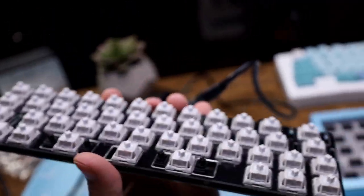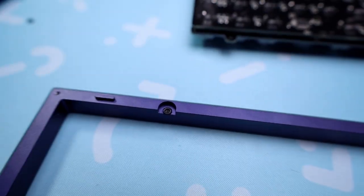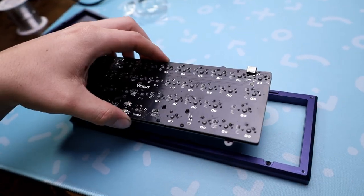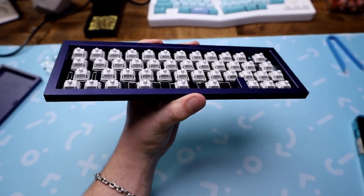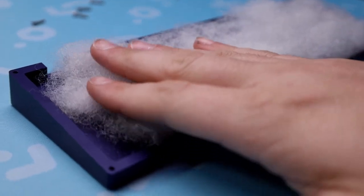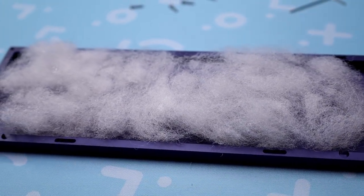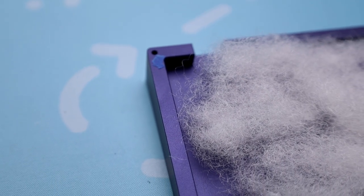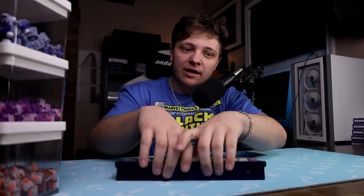After doing that, I needed to assemble the whole board, and then we can do the mods. Assembling is pretty easy. You turn over the actual top part of the case. First, you want to seat these little O-rings — put them in first, they have a little spot for them on the top part of the plate. Then you put the plate on, then you get the screws with another piece of that, so it's like double. Then you screw it in and the plate is secured. Because we soldered, the plate and the PCB are already connected with the switches. Then I went ahead and put some of the included polyfill from CanonKeys into the bottom — spread it all apart, make sure it looks even. It's going to be a little bit difficult to close because there is kind of a lot; you can do less if you would like. Moving on to the next mod, we are going to be force-breaking this thing because it is metal on metal. I use two little thin pieces of painter's tape, put it near where the holes are going to be screwed into, and that's it. It just forces it to break, and it makes for a way better sound test.